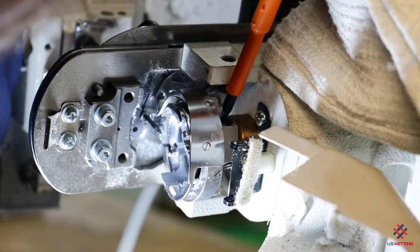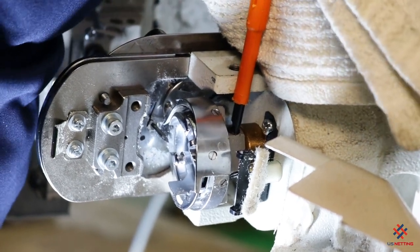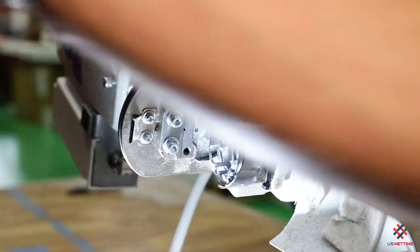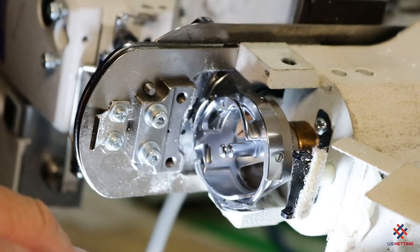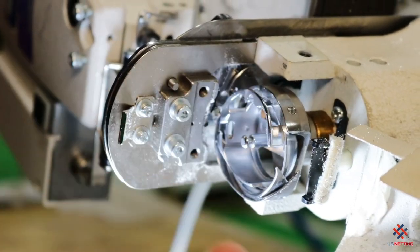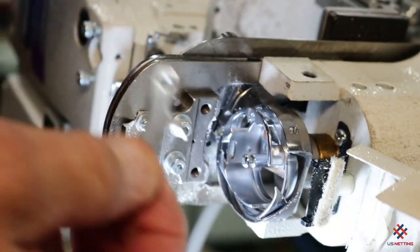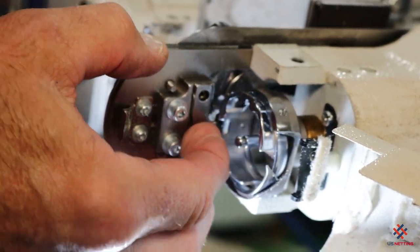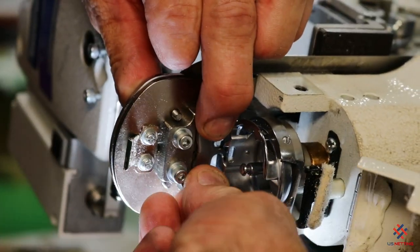You don't ever want that screw to come loose — when you do have to take it out you'll need two hands. Then put the position bracket back in: turn the needle up out of the way, position that little opening in the basket straight up at 12 o'clock. There's really no adjustment — the bracket will put it in the proper place. The tooth goes into the notch and the two screws go back on.